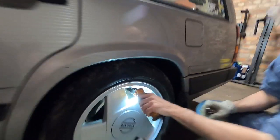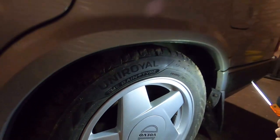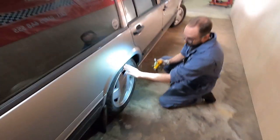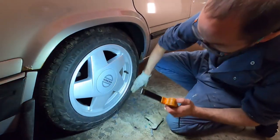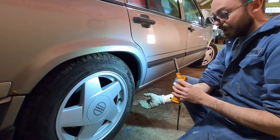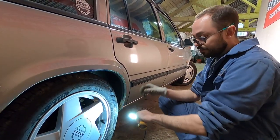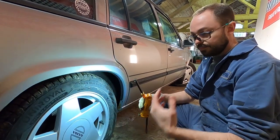Having a quick look at the brake pads - they're a bit difficult to see but you can just about make them out. The brake disc looks pretty decent - no big ridge on it. The pads have got plenty of life. Checking the rear wiper too - that's nice and new. The valve stem looks good - not torn, not perished. We can check the tread depth on these quite easily, but we're going to be taking these wheels off anyway for the service side of things.